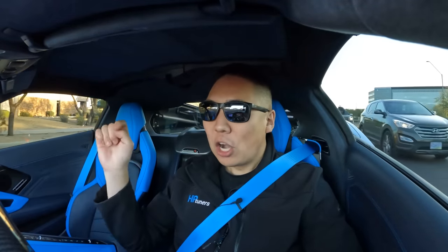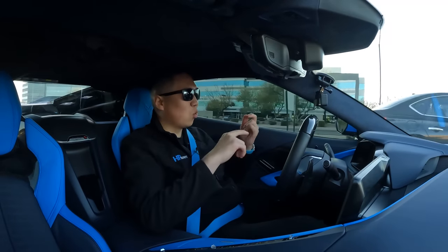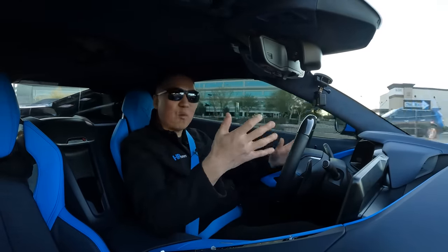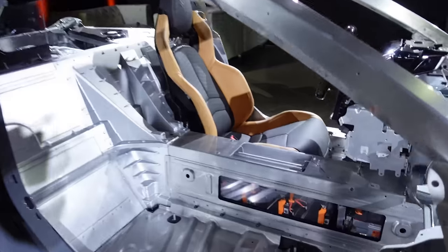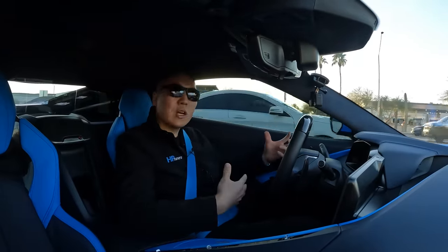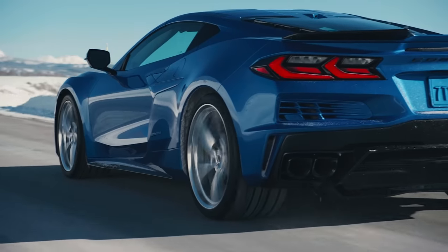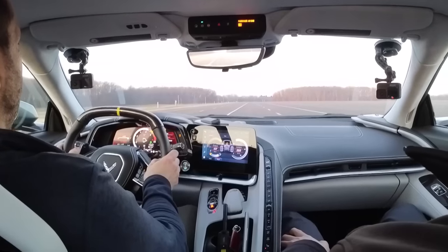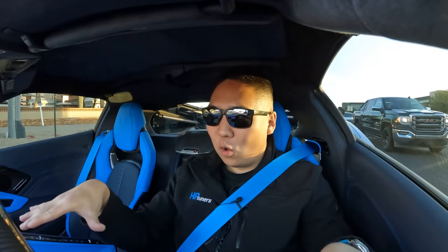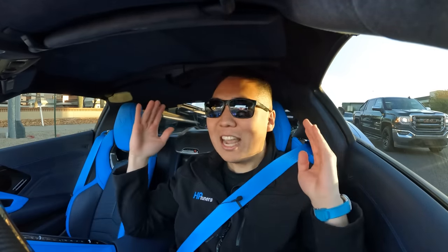That is a massive 135 pound-feet advantage compared to the Z06. And it means it's all-wheel drive - it's the world's first ever all-wheel drive Corvette and the world's first ever electrified Corvette. It's not a plug-in hybrid; it's just a hybrid for performance. It's got a tiny 1.9-kilowatt-hour battery pack in the E-Ray, and they put it along the central tunnel for better weight distribution. There is a weight penalty - something like 200 to almost 300 pounds in addition. Dry weight for the E-Ray is quoted at around 3,770 pounds, but it's hard to compare apples to apples because it also has the wide body treatment with bigger wheels and more body. It more than makes up for it in the power increase. It's the quickest Corvette ever - the E-Ray does 0 to 60 in 2.5 seconds, quarter mile in 10.5. We did launch control in the cold, about 40 degrees in Michigan on all seasons, and it just hooked and went.